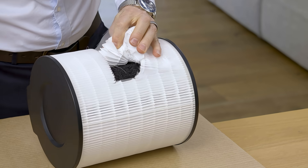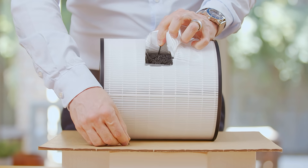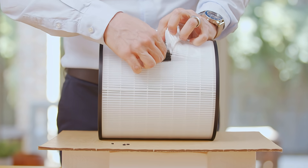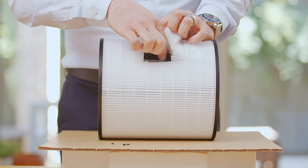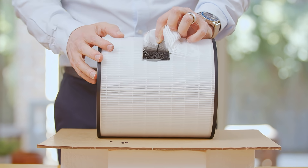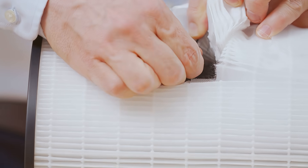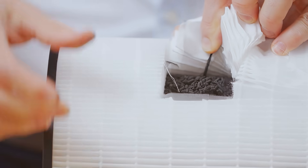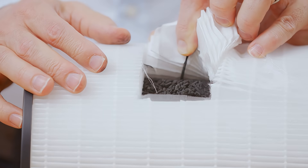We can see there are only a few granules of activated carbon — not very much at all. There's a lot of daylight in here, so there's a lot of room for air to bypass that activated carbon. This carbon is actually bonded to the inner surface, which unfortunately is not going to remove a lot of chemicals and VOCs from the air, and it's also not going to last very long in use.